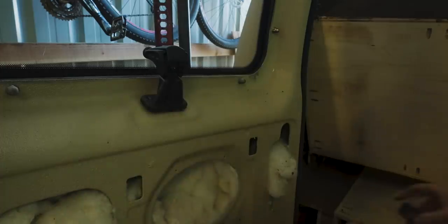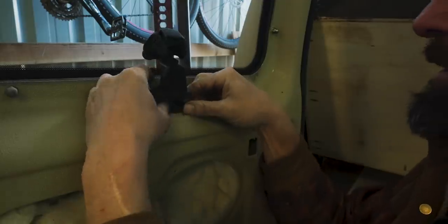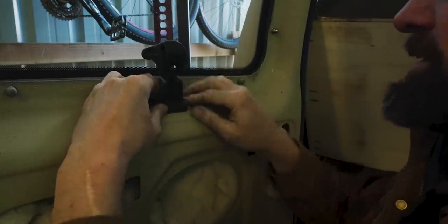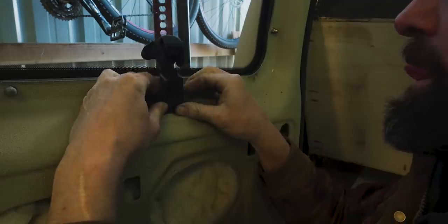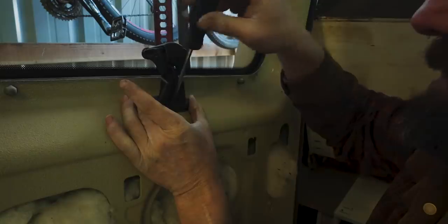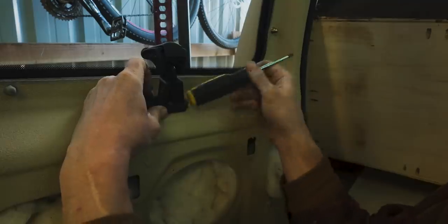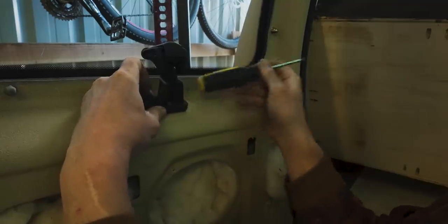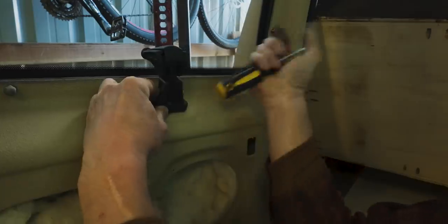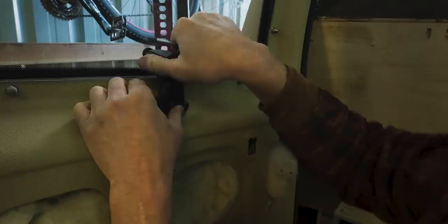Get it to line up, then take your buckle and thread it on to the nut in the window. You'll have a little backing piece — just put that in underneath, put your top piece on, and get everything to line up. I'm going to use the back of my screwdriver to nudge it over a little bit, get everything lined up, make sure the buckle can actually work, then go ahead and start putting in your other screws.